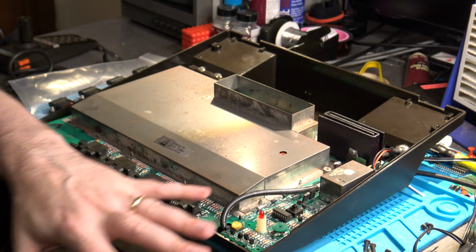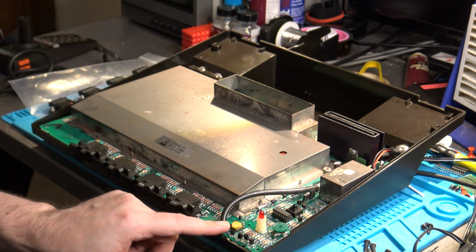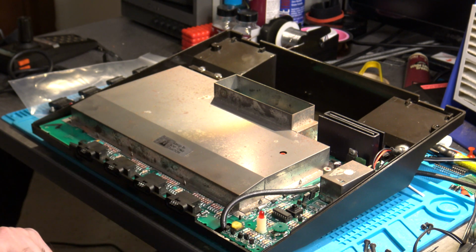So before you really start all these adjustments, one of the things you're going to want to do is spritz it up with some alcohol and get it up in there, or use the contact cleaner so that we can try to clean some of that out before we do our adjustments. Let's do that first. I'm going to change the camera zoom here a little bit so we can focus more in on this potentiometer real quick.